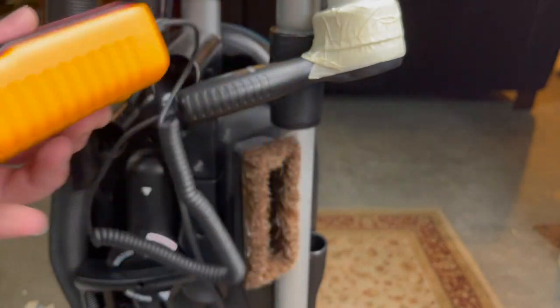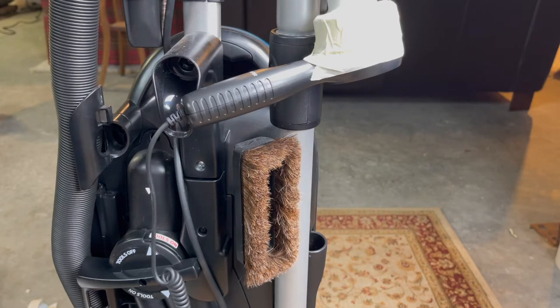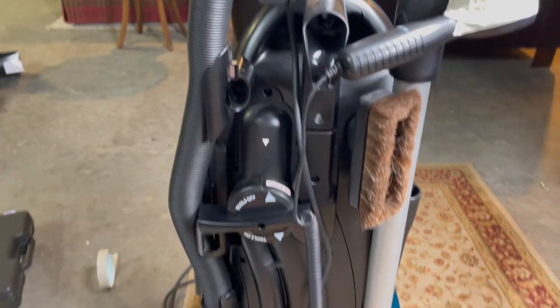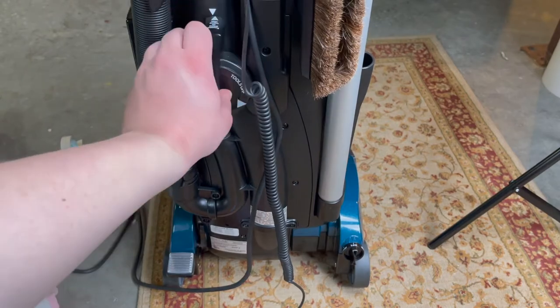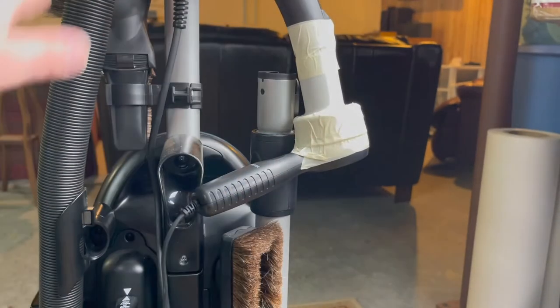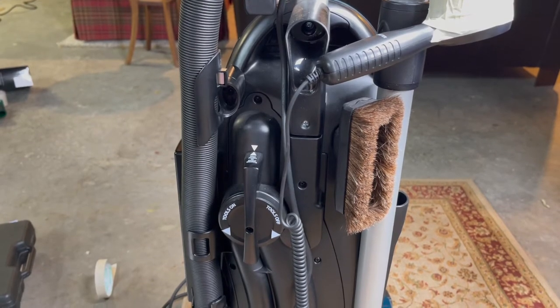So as you probably saw, 2893, that's about 75 and a half CFM from the hose in tools setup. So pretty decent performance. Obviously, the air path going down to the floor is much more efficient than the tools, because if you remember, the cleaner motor did, I think, about 85 or so on the floor, because obviously it doesn't have to go, it just goes through this valve and down to the floor rather than up and around this circuitous path from the hose. So that's kind of interesting. But 75 and a half CFM from the hose.